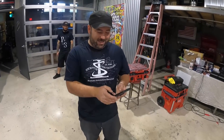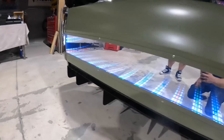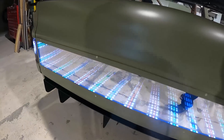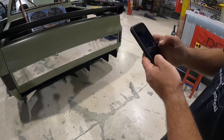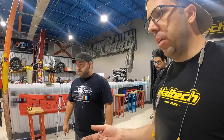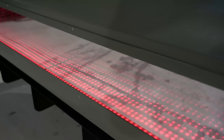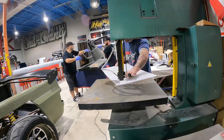Steve, what are you doing — you're just standing around doing nothing, is the truck done or what? Oh my god, look at that — some crazy lights going on in there! What you're seeing right now is one of the limitless show modes available with the module. Simulating the brakes — some red, yeah, look at that. There are redundant brake lights built into it. You're using neopixels for custom lighting, but you always want to have some really bright redundant brake lighting because the neopixels themselves aren't really as bright as you need them to be. Next step is to get this wired up to the brake pedal and the headlight switch so it can function with the rest of the truck.